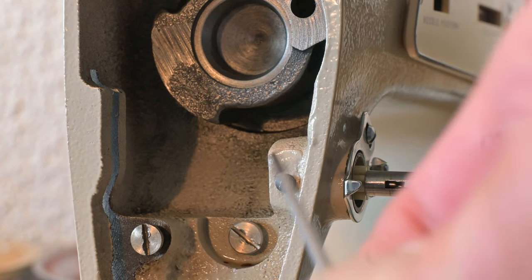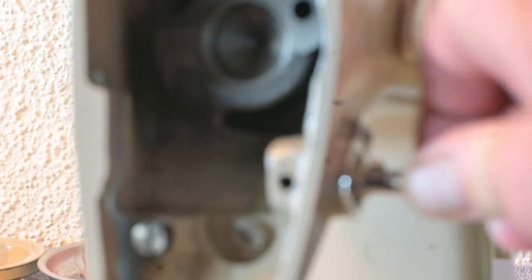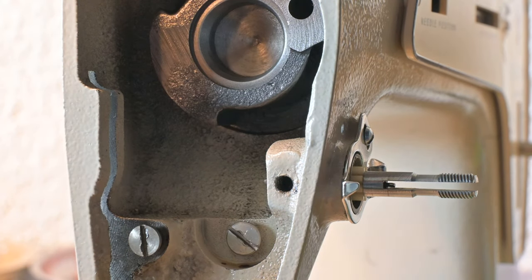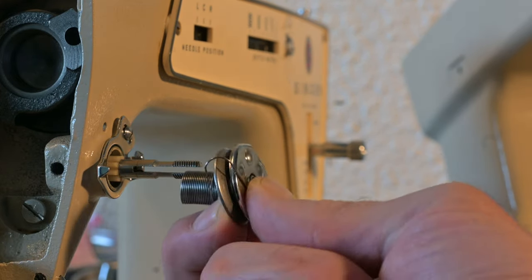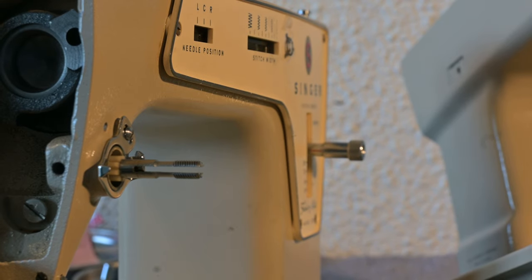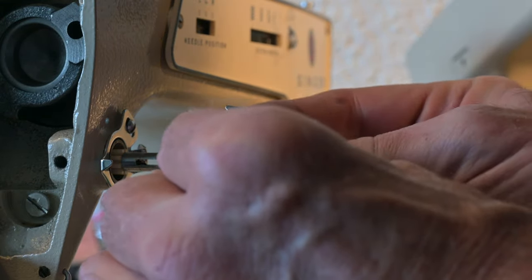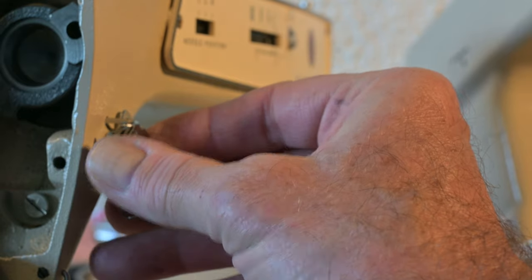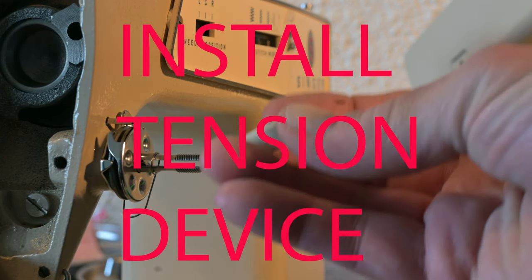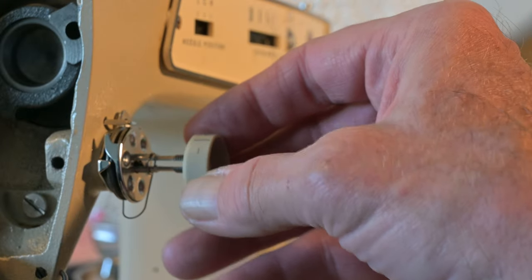Here's the screw to tighten that. That should seat and tighten — there, that's firm. Now I want to get the tension assembly, and the assembly is constructed as follows: we have the spring, then the two discs, and then the thread guard. The spring has a tab for going on that horizontal slot. I've got it together — spring, discs and guard, and the back tab of the spring. The guard has a probe that goes in there. Get the plus/minus indicator with the plus and minus on top. We remember to put the crossbar that way — it's easy to reverse it, an easy mistake to make, so I won't.